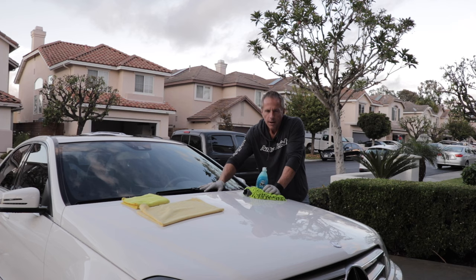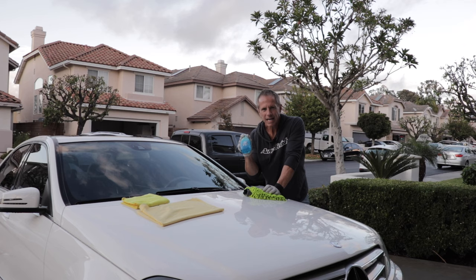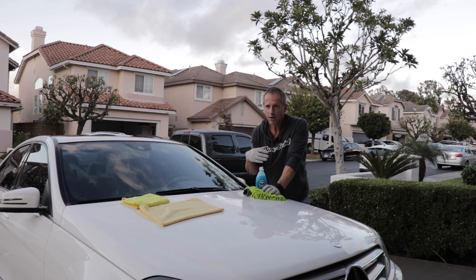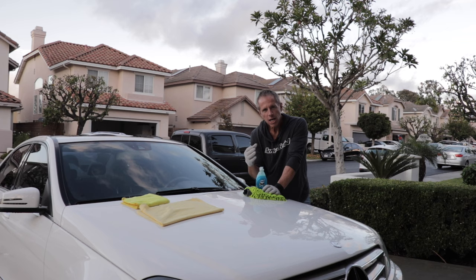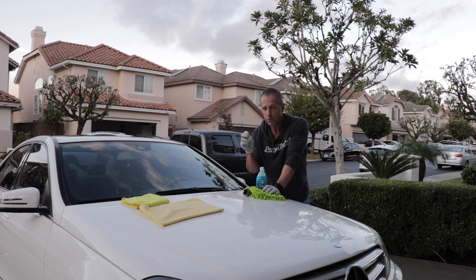The rule is this: when it comes to washing your car, if you accept that the bulk of the dirt is water-soluble, you don't need to overthink it with a grease-cutting formulation. What you should be more concerned about is dedicated car wash soaps. They're dedicated for your car because most contain lubricants — in the form of silicones or other ingredients — that help lubricate and encapsulate the dirt so the washing experience is more friendly to your car paint. They're not going to have surfactants with grease cutters in them. That's the trade-off, but you just need to understand the differences.